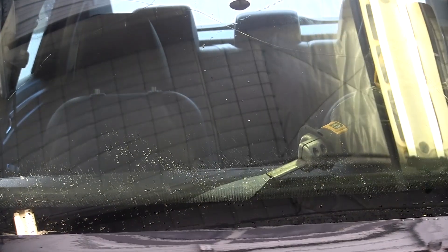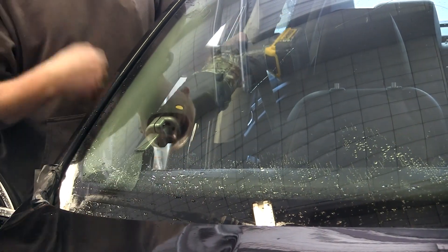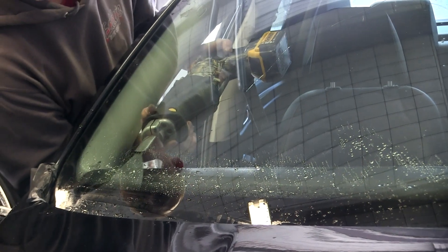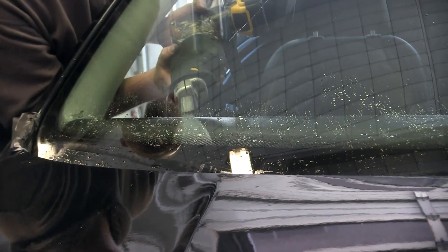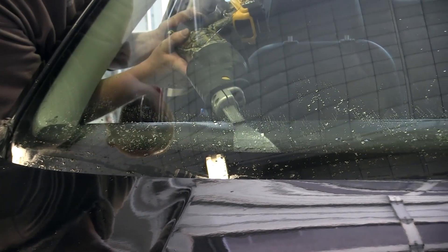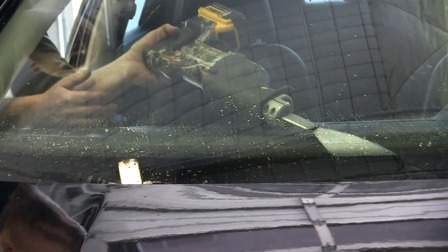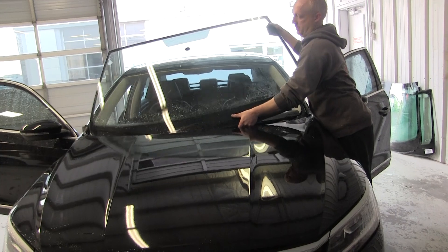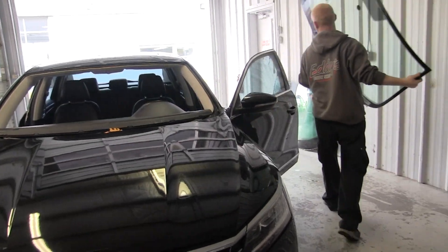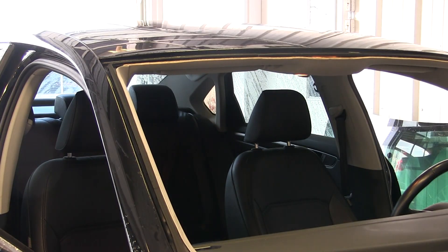This is a pretty fast process. Half that bottom is loose and he's just got the other half to go. He's going to cut that out and this windshield will be ready to take out. He's been doing this for 20 years and is very good at it. Now he's going to take the glass out — notice how he's handling it. He's going to go set it down, get the new one, and get it ready to put in. You can see how all the urethane is on the pinch weld, and he's going to come back and trim that up.